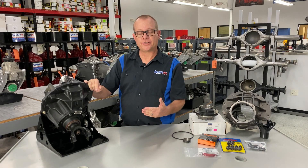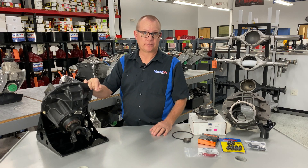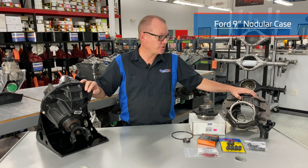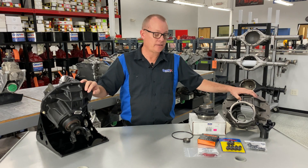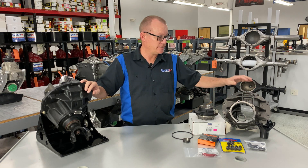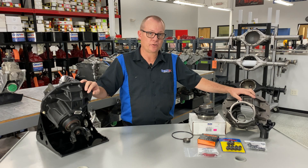So let's talk about our N-Series Ford 9-inch gear. Any quality piece of anything starts with quality components. Some of the components that we use in this gear are the Ford Racing 9-inch nodular case here. We had these built specifically for us — Ford Racing had stopped making these a few years ago, and we got permission to use the same molds and have the same machine shop build these for us. So we're starting with a good quality Ford Racing nodular iron case.